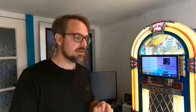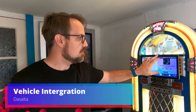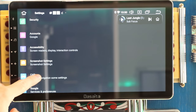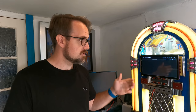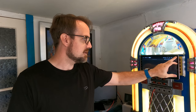You have the option of connecting it via the standard harness and they do give you pre-outs as well. From a vehicle integration perspective, you have the ability to set the steering wheel controls by going into the car settings and then into steering wheel keys, very much like any other Android-based head unit. As soon as you've connected your head unit to a CAN bus decoder for your vehicle, you can program your buttons using this app.